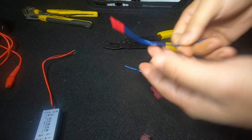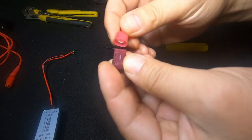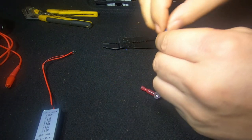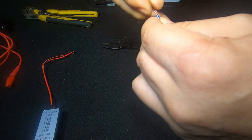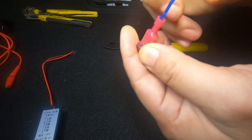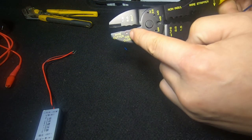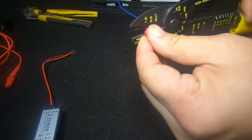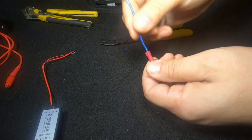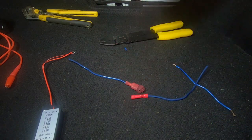I'm not going to do that because I don't need to, but I just wanted to show you that's how you would extend your cable. The same goes for when you use wire T-taps. In order to put a cable in here, fold it over and enter it into the spade connector. Follow the color code — this is red, and we have red, blue, and yellow. Simply crimp it down — you just have to press down hard enough to get a good crimp. After you crimp it, make sure you tug on it and confirm it's a secure connection. That's how you would extend your cable so that it will reach the appropriate place.